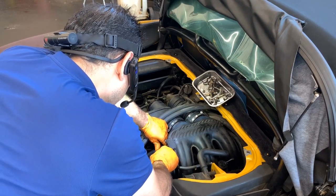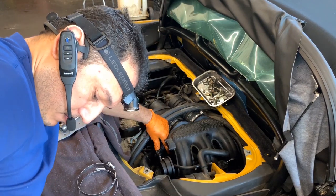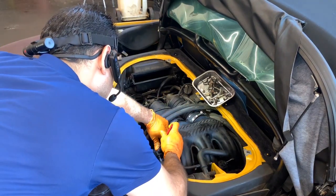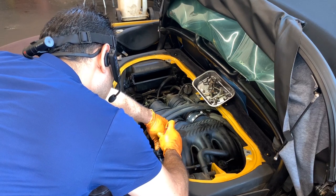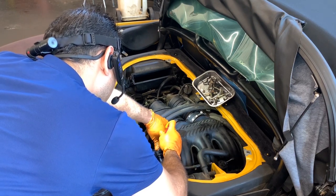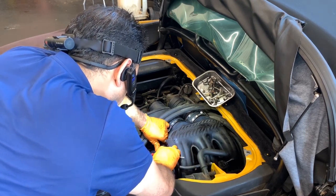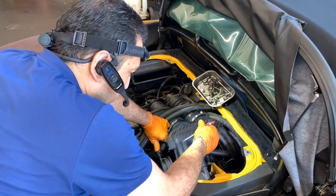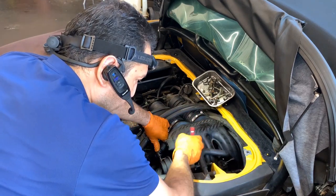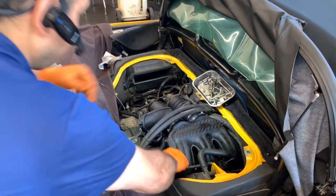It's just an O-ring swollen a little bit. I mean, this manages oil, so in this case, it's actually the O-ring a little swollen. So if you see that, see what I did in there? Just went with the screwdriver. Don't push it hard because otherwise you will cut the O-ring, and that's it. It's in.